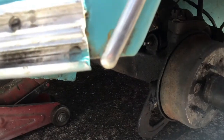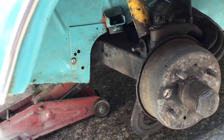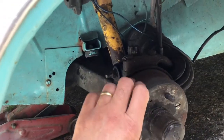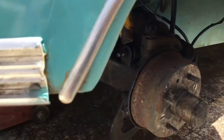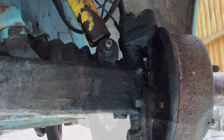I've removed the front wheel just to give you an idea of what the suspension looks like. Look how small this front drum is — it's absolutely tiny. Under here I'll show you the greasing points. They often get seized up and can be quite temperamental, and it can lead to the brakes pulling to one side.